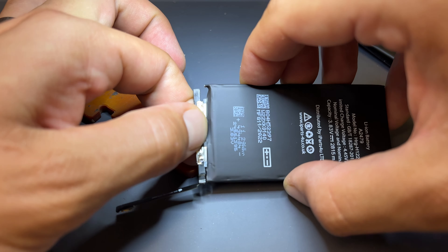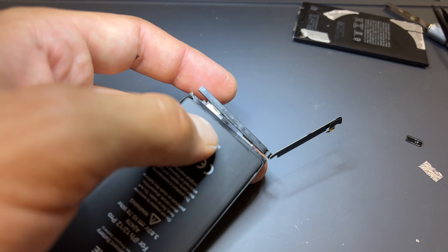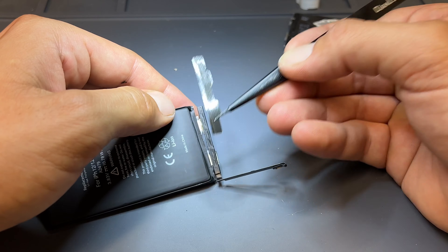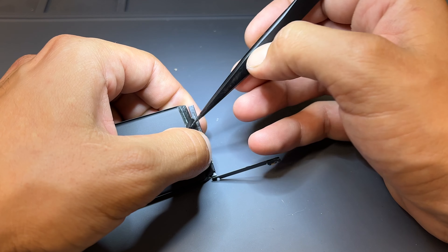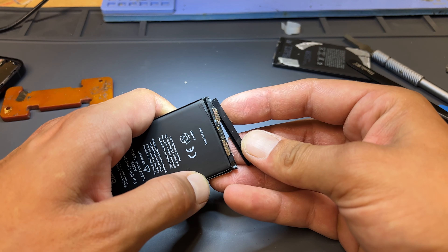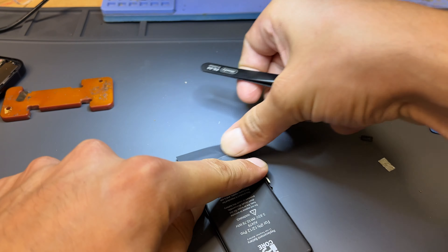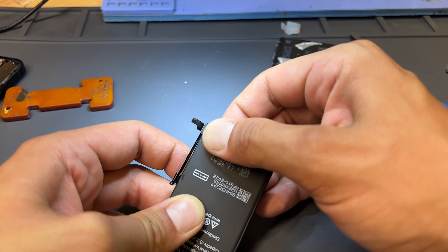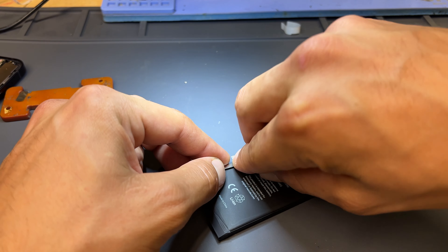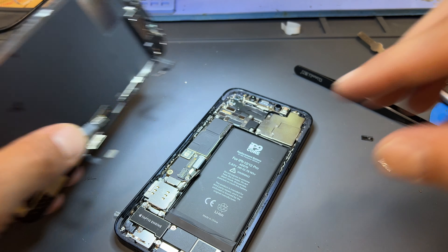With that secured, I'll give it a little pull to make sure there's no movement and that the welds are secure — which I'm happy with. Now we need to fold over the little corners on the battery that sometimes get in the way. I'll add the double-sided tape from the packet and stick it onto the inside, then fold over the BMS. Now we can place the plastic sheathing over the battery terminals, and finally go on with the tape fold. We can now take the tag-on flex and attach the female end onto the now prepared battery. Now I can reattach the screen and the proximity sensor at the top, then attach the battery.